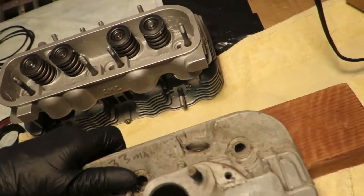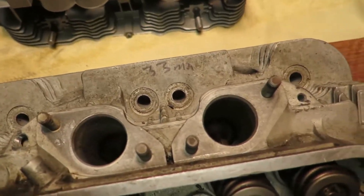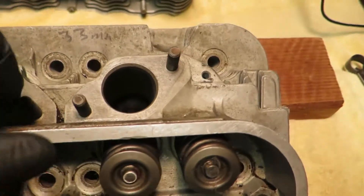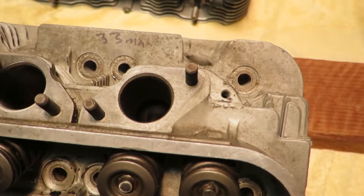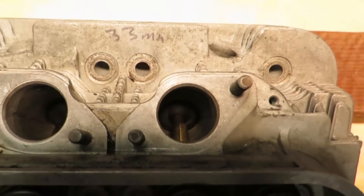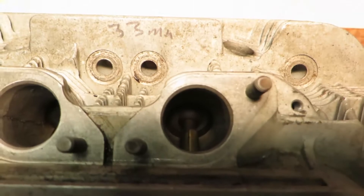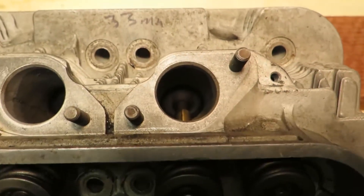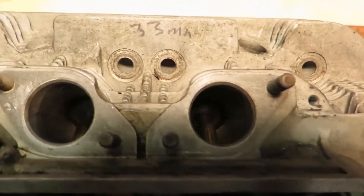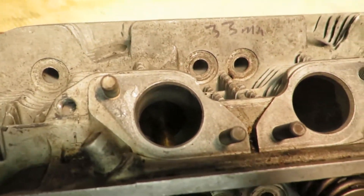I'm comparing the intake ports done by Volkswagen on the castings here. They're much more straight and not very curvy — they go kind of straight across. Surprisingly, there isn't any kind of hump where the valve guides are. That's just the way the casting is, that's the way they made them. Usually you see a little bit of material there, but they were cast that way with no machining marks.